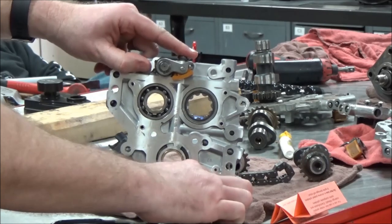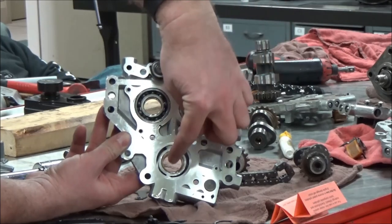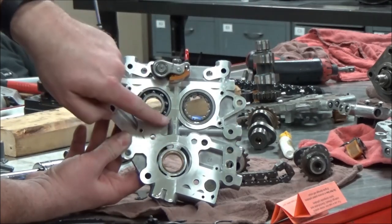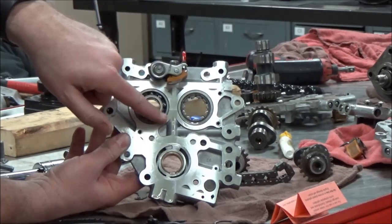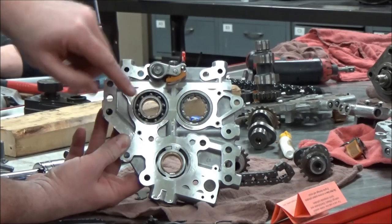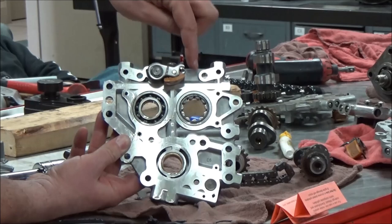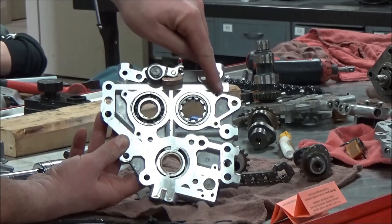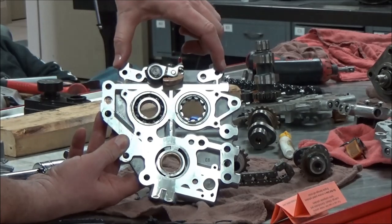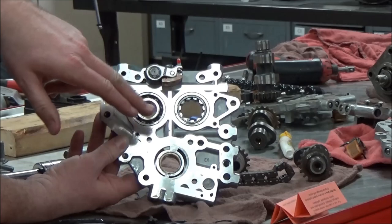Because we're going to feed oil through — that's going to go to the oil pump. Inside this oil pump, it also feeds right up through this channel. That little oil hole is what sprays oil out at the camshafts — that's actually forced lubrication right there, so it's pretty important. The oil also goes up through here, filling some of these other galleys, which feeds the lifters, which feeds the oil jets, and so on.